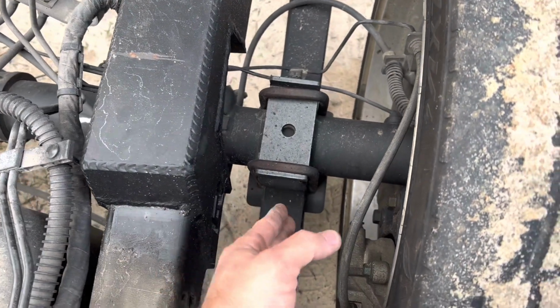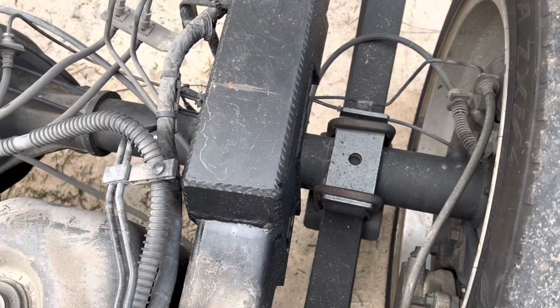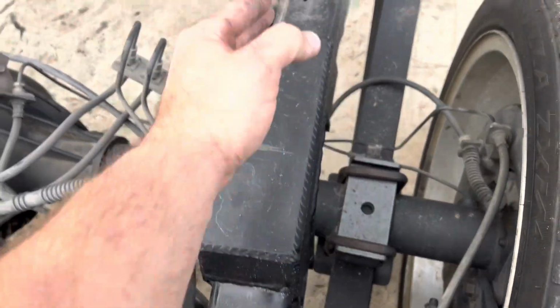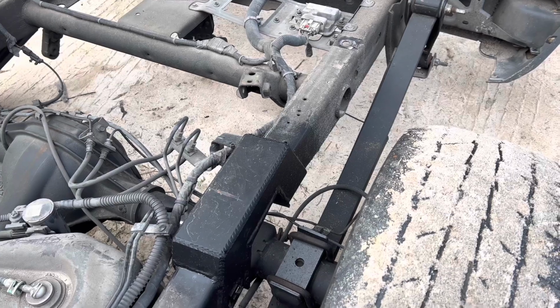When you do a 12 wide on these trucks, the brakes are right up against the notch. If you do it like a 26 by 12 max offset, puts it right here against the notch. Reckless developed this notch that comes in and gives you like an extra inch of clearance. Very nice product. I've done a couple trucks where I wish I had that notch.